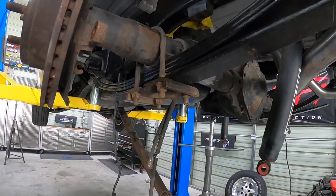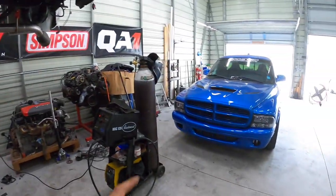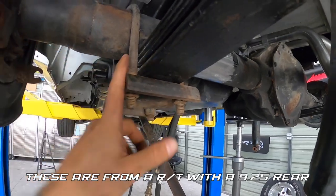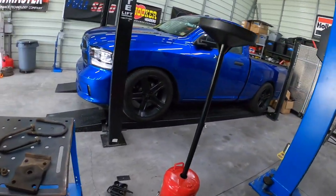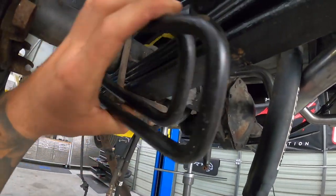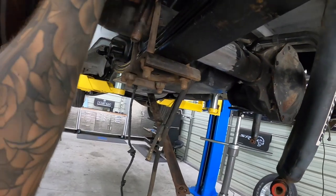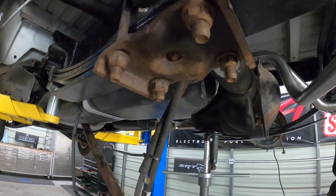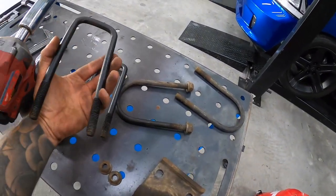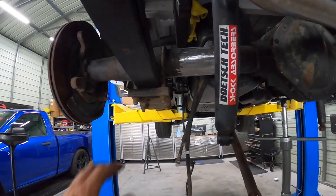This is why sometimes you don't throw things out — these are from a Dodge Dakota. The Dodge Dakota has a factory axle flip where the axle rides on top of the leaf springs, so these are the factory hardware. Go get those from a junkyard because you're going to need them. With the standard square u-bolts you'd have to tighten the bolts from the top down, but the round Dakota u-bolts are a better setup. Everything fits and works beautifully.